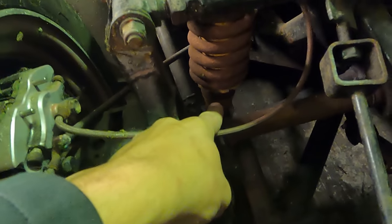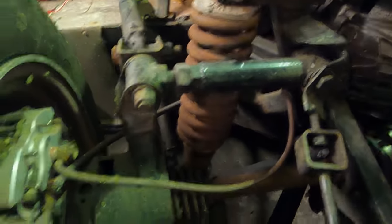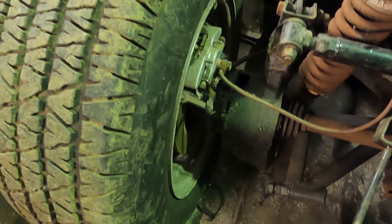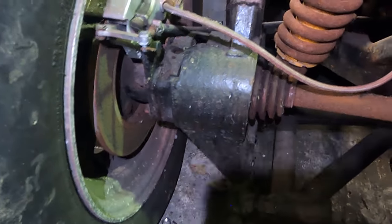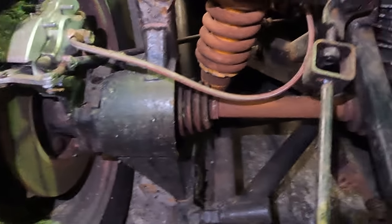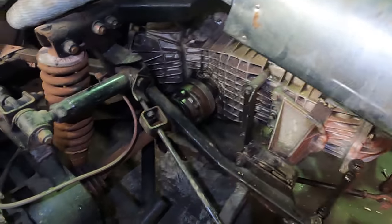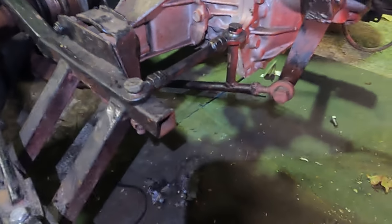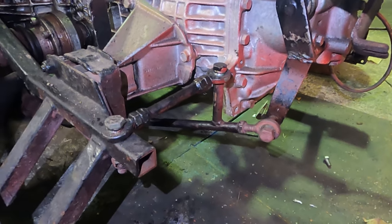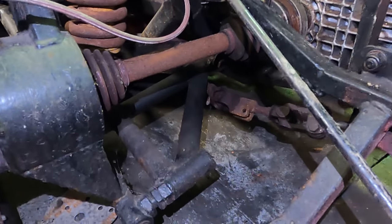The rear shock absorbers are coilover-adjusted — by coilovers, you have a coil spring over adjustable shock absorber which can be adjusted to allow the ride height to come up and down. They are brilliant, but there are some options and things we're going to need to change. The rear hubs have been made by Ivan himself, and no disrespect to Ivan, he's done an absolute fantastic job, but there may be some kits out there that we can really improve on the look and style. The driveshafts we'll be able to send off, get them rebootted and powder-coated. The gearbox is a five-speed UN1, and I'd love to whip that out and throw a limited slip diff in so we can do some donuts. He's done a lovely rose-jointed gear selector at the back here. My only issue is it doesn't feel like it goes in nicely, so cleaning that up, making sure we can grease it and see if it moves — if not, we may have to change it.